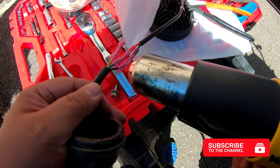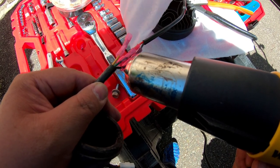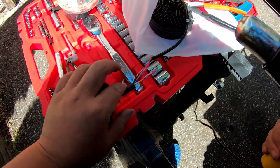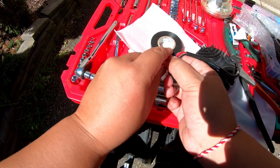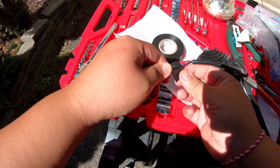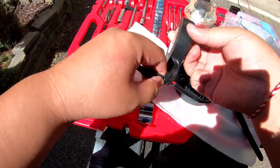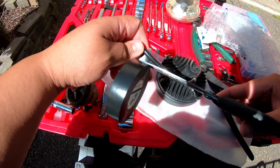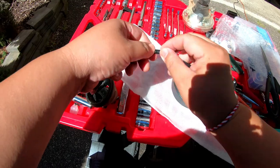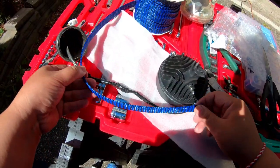Now with your heat gun, just shrink the tubing. I'll just let it cool for a little bit and we'll come back to it. Once it's all cool, I'll come and tape these together so they don't move around. Make sure all these wires are protected because it's going to get wet, it's going to get muddy. The ATV is going to be vibrating and jarring from all the movements, so make sure you protect it really well. Also make sure that you're using good electrical tape — there's some that does not stick well and some that sticks really good. For extra protection, I just like to put a little bit of this on to help protect it even more.